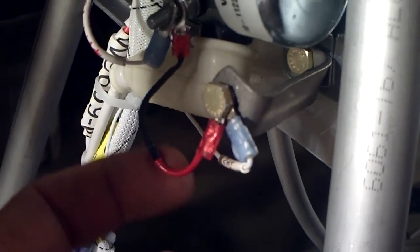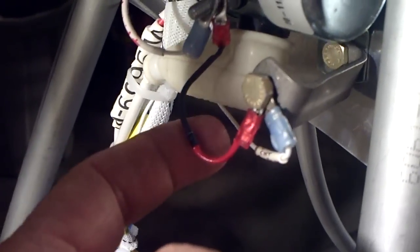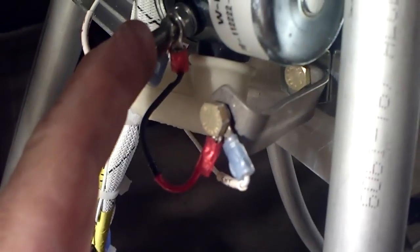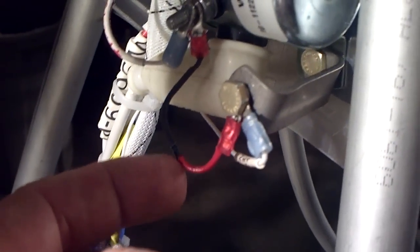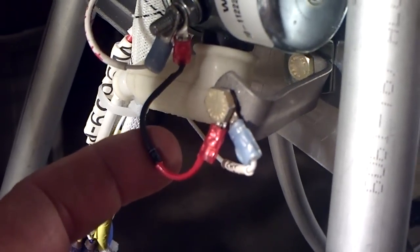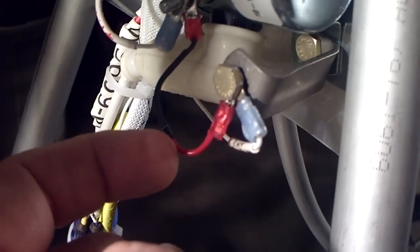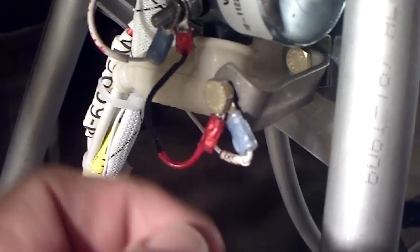When you're wiring up your Excalibur, remember to put this diode into the circuit system with the cathode facing to the small 12-volt terminal. And the anode — the end without the band, there's a little white band on that diode — goes directly to aircraft ground.